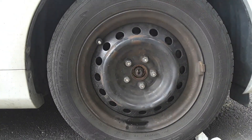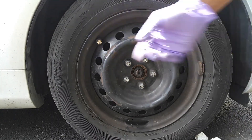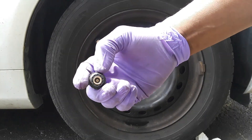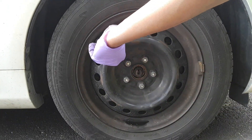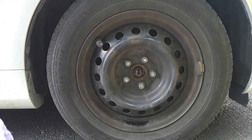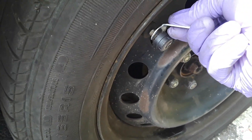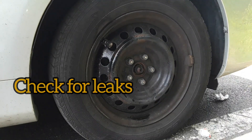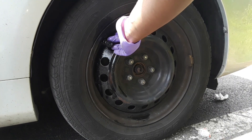I place the anti-theft nut on it. Inside the sensor you're going to see there's a black gasket — this black gasket has to be placed in the sensor to prevent it from leaking. Once that is done, you turn the sensor onto the valve stem and use the wrench provided to tighten the anti-theft nut. This nut will prevent anybody from being able to remove the sensor and steal it. After that is done, use soapy water or Windex to test if there's any leak. If there's no leak, go ahead and use the dust cover to protect the sensor.